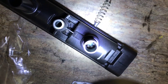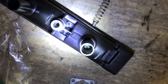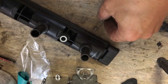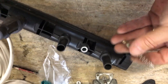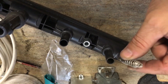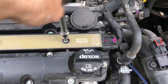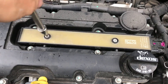Let's take it over to the bench. Look at all the green stuff down inside that coil — this might be dead in the water. We'll stick it back in. This is a 2015 Chevy Cruze with a wicked misfire on cylinder number four. I think this coil might be dead in the water; I'll let you know if there's any warranty on it, but I don't think we're going to have any luck.